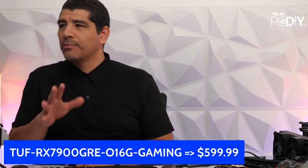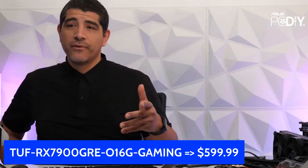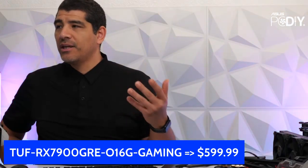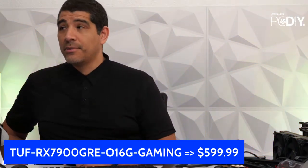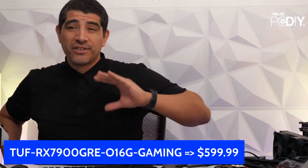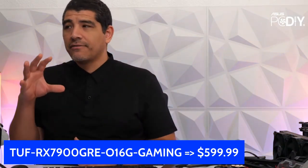So as an overall approximation, if you're operating in P mode, the performance mode, which is the default, running essentially 3DMark at a 25C ambient temperature would give 56 degrees. I think that's very reasonable in terms of temperature performance. And then even in Q mode, so if you put it into the quietest mode, which won't affect the power performance, it just brings down the fan curve, that would be 62.5 degrees.